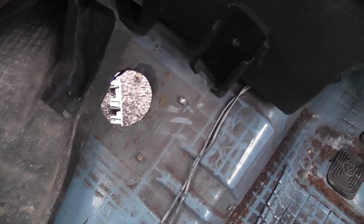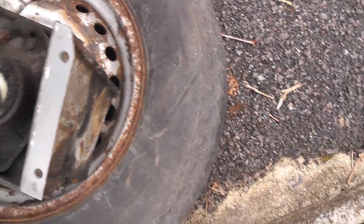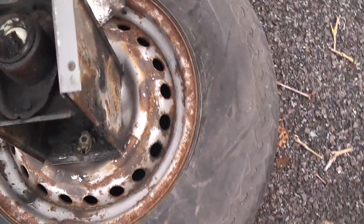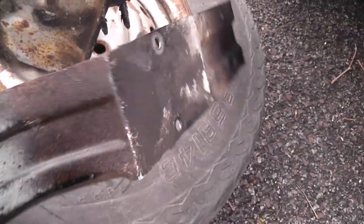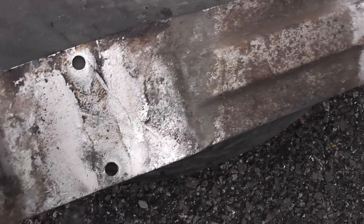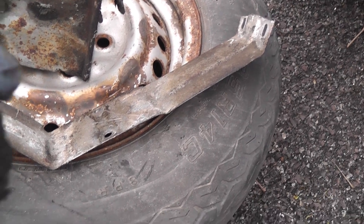The gear shift mechanism is entirely out of the van now. It's only held in with four captive nuts on one side and four bolts coming up from the bottom side to get the gear shift out. That's the box underneath the van — four bolts with a 10mm head, so they're M6 bolts. I also took off the two bolts at the bottom which go into the blocks on either side of the shift, which are badly worn in this case.